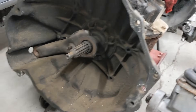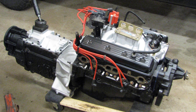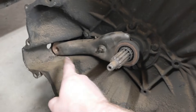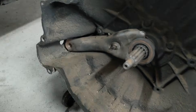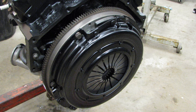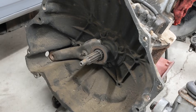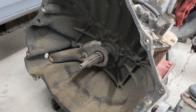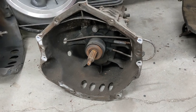The first hydraulic clutches — like this SM465 — have a bell housing that looks identical to the one that was on my NV3500 or NV4500. They have a hydraulic slave cylinder that bolts in here, but it goes in the opposite direction as the Camaro one, and it's still push clutch. This one is easy to convert to an internal throwout bearing if you need to.